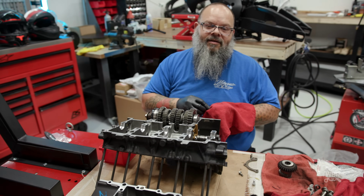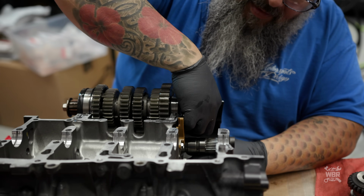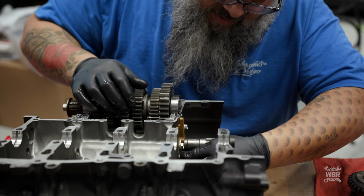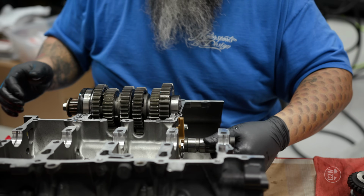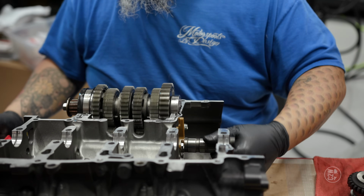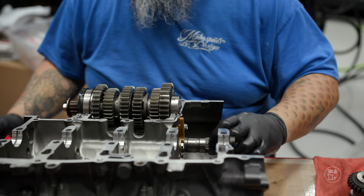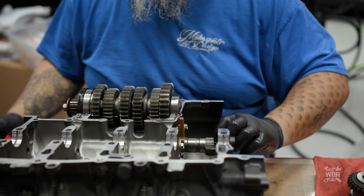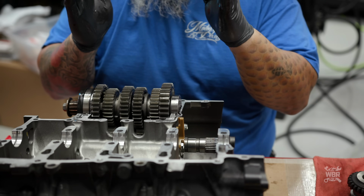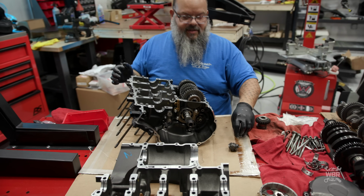It should be good. I'll tell you what I'll do, I'll get these two bolts started so this thing's not flapping around. And I'll turn the case toward you so you can see what's going on. I hate things flapping around. Do you hear that? It's like stuff is just rubbing together. Right. So once I tighten this bolt to its spec, that should be silent. We'll find out soon. It just takes that half millimeter of it being compressed into the engine case that'll get rid of that. Man, that got really heavy really fast.